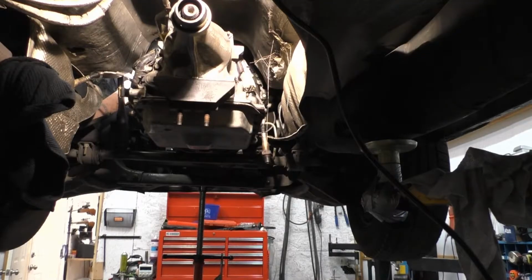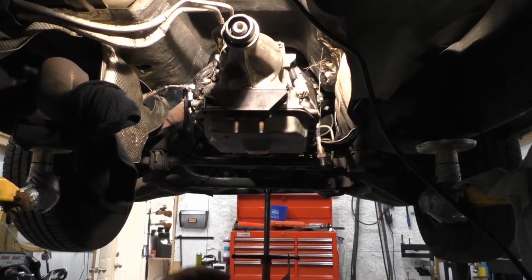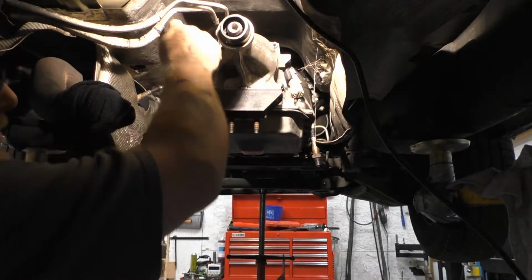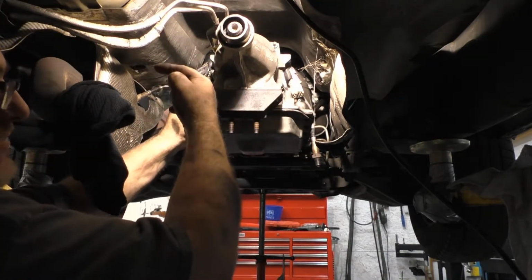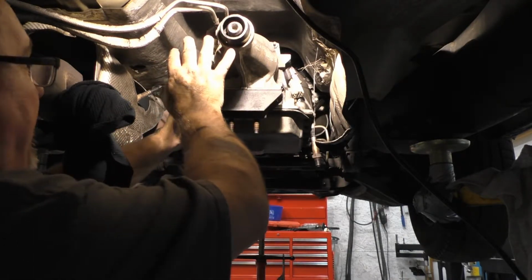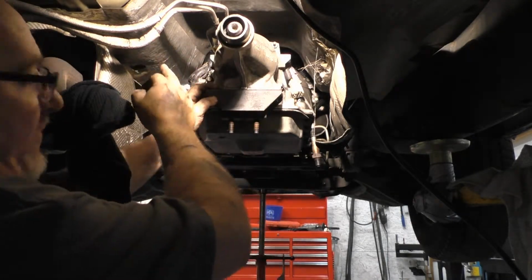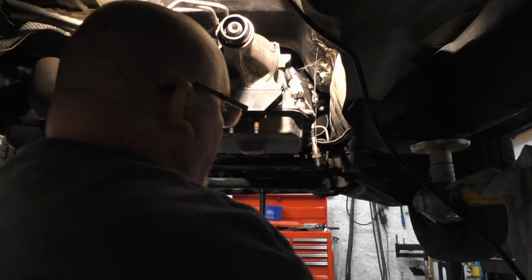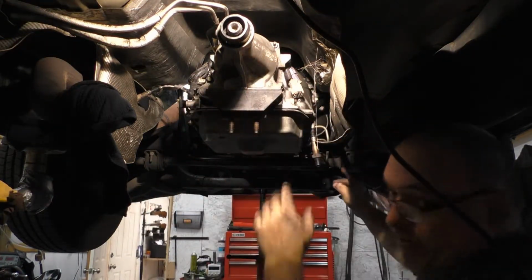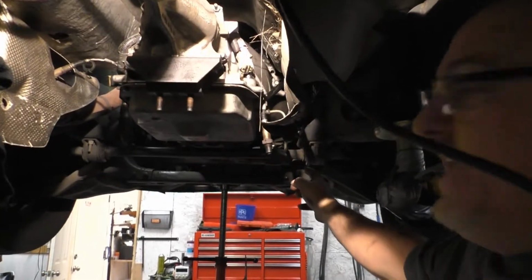So I'm plugged in, the camera I'm talking about. So the fuel line bracket, when you're looking from the rear here, it is on the top left, driver side. Looking from the rear, there is a bracket that holds the wires and the wire loom in place, and also the fuel line clips into it. Got that mounted. We mounted over here. We mounted our starter, and our ground cable is fixing to be next.